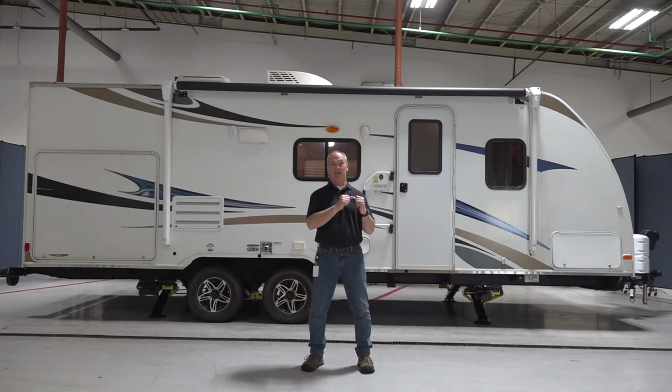Let's go ahead and program your zero point. So typically, the OEM delivers the unit with a zero point programmed into it. However, there are certain situations where the end user will want to program their own zero point, and that is in the troubleshooting process, or if your eggs are rolling off your counter, you're going to want to set your own custom zero point for your system. Let's go inside the RV and I'll show you how to set zero point.